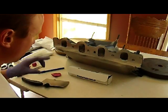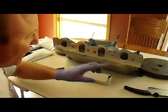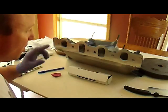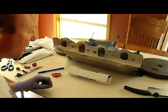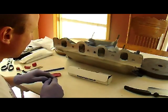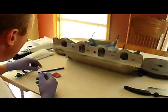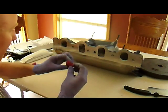I wanted to show some epoxy filler going in these intake ports. This is for a 351 Cleveland, and this is an Edelbrock RPM air gap manifold. I have some Roush intake wedges to reduce the size of the intake port and I was having a misalignment. So I'm making these wedges using some of this Moroso epoxy — seems to work pretty well — making wedges that look similar to this clay mock-up here to go in the port.